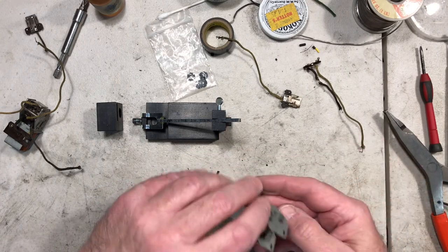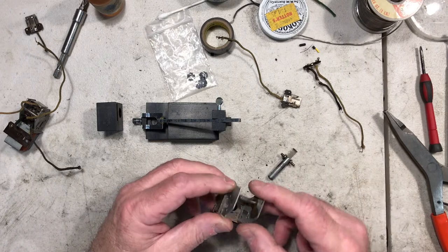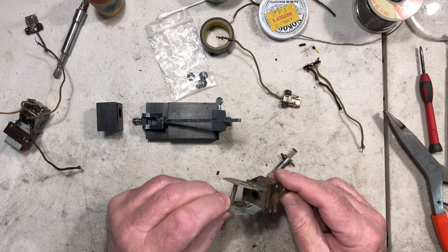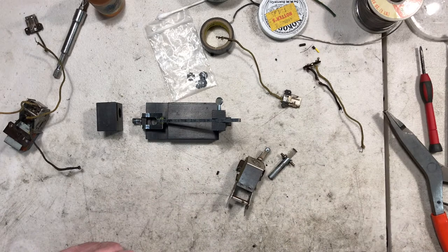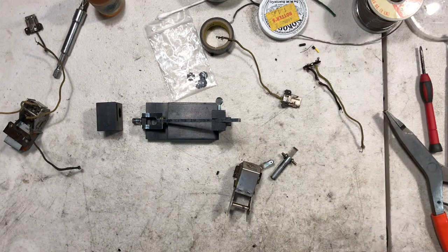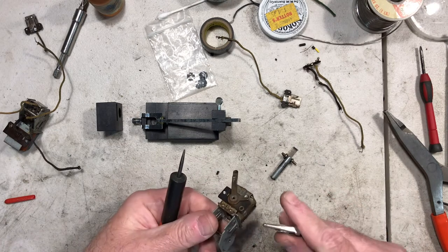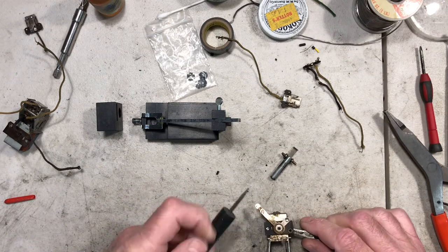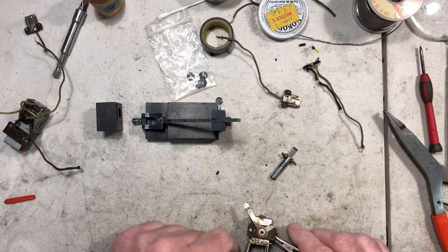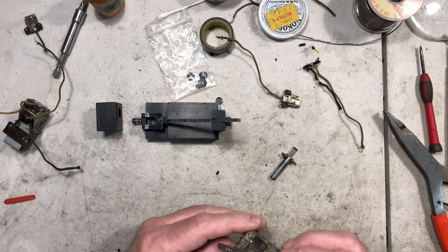The plunger — let's pull that out of there. That's all there is to these. You can see how dirty it is, it's been worn out, it's got some rust in there. What I like to do is check and see what kind of continuity we have on the winding. It's hard to burn these out. We got a very dim light — as long as there's a dim light, we should be okay.